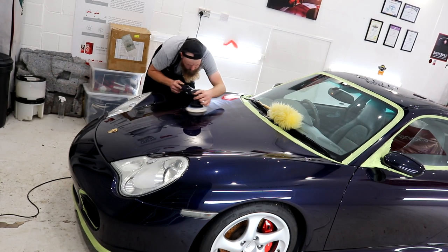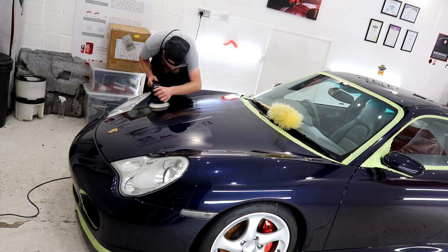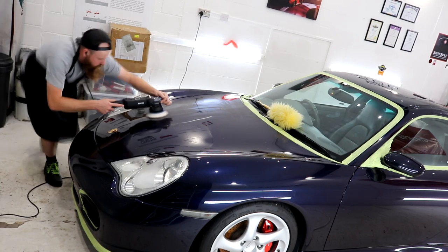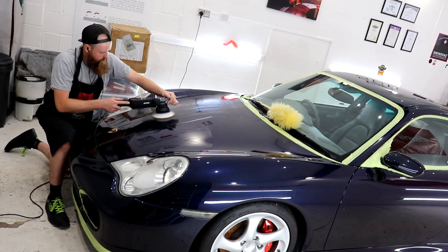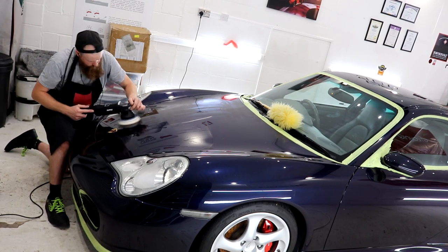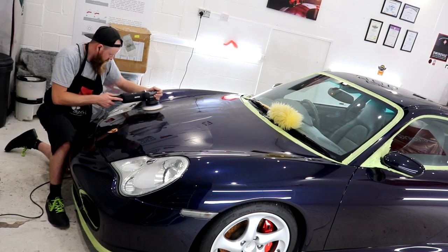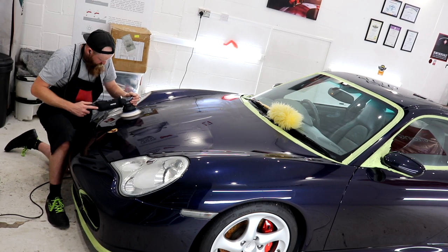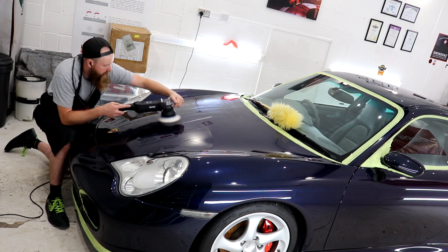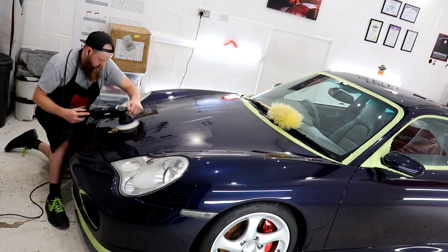The thing you tend to find with the refining stage is that you can spread the polish out much further in comparison to compounding. Compounds dry out far quicker, whereas the polish remains runnier for far longer. One good way to maximise pad life and to avoid the pad from becoming oversaturated, if you are able to continue polishing the next section of paintwork without applying more polish, then go ahead and keep polishing. I picked this little tip up from Larry at Ammo NYC and have been using his technique on every detail ever since. I mean, why would you want to apply more product when you can clearly see that the surface is still being nicely polished?